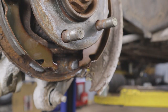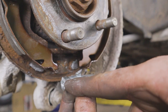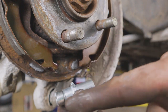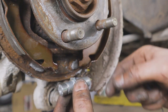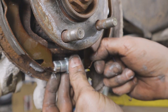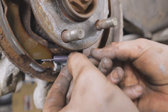Finally, we need to assemble the bottom. Your kit comes with a new adjuster screw — two parts: the outer body and the screw in the back. The screw faces the rear of the vehicle. Put anti-seize all over the threads of that screw, screw it all the way in, and load up each of the pockets on either side with some more anti-seize. Then that assembly goes in, and your last spring goes in at the bottom.